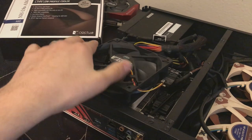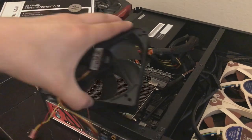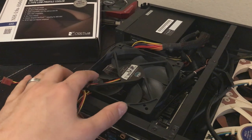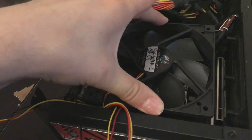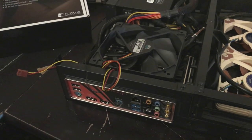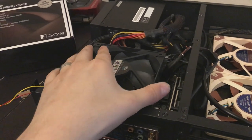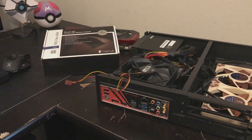So I tried adding this Cooler Master fan — one of their silent fans — after taking out the 92mm fan, trying a higher CFM or higher RPM option. You can buy these in four-packs for ridiculously cheap. I was able to screw it in and secure it pretty well inside here. That does help reduce temps, but it is relatively loud.